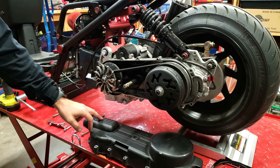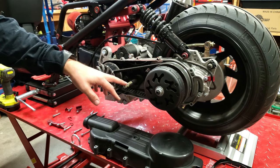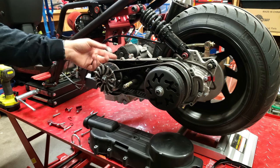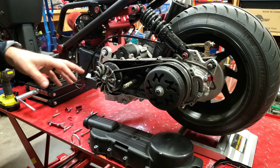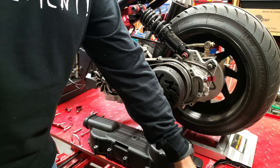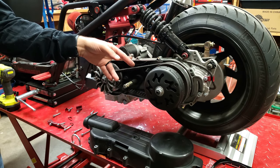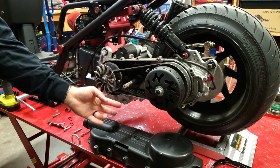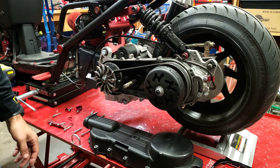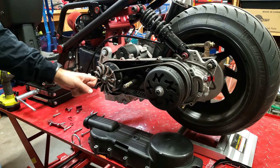Here's what it looks like with the case pulled off. You can see it exposes your variator - your front pulley - and then your rear pulley with your clutch, and even your kickstarter mechanisms. Those are what we're going to have to pull out, along with the belt, so we can get the backplate on. One really important thing to keep in mind with an ankle biter: you must put a backing brace on there. This one comes with a stainless steel plate, because otherwise I've seen pictures where the GY6 case can actually crack. If that cracks the wheel is gone and it's really unsafe, so make sure you put a backing plate on there.